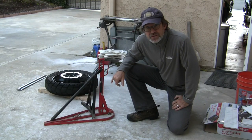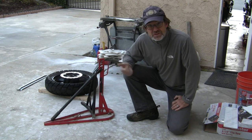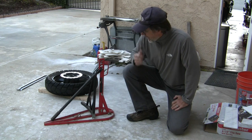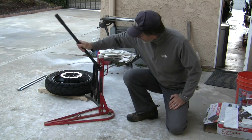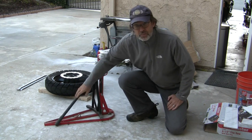As you can see, I've had this tool a while — it does have some debris on it from being stored in my outdoor shed. Pretty simple design. Different widths, clamp down on it and break the bead. But with motorcycle tires, particularly those that have a rear disc brake on them, you've got to pay particular attention to your disc, or rotor as it might be called in automotive, where you don't want to damage that. And the bead breaker will damage it if you don't make a little bit of an adjustment.